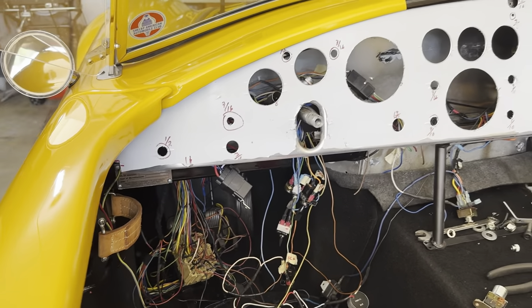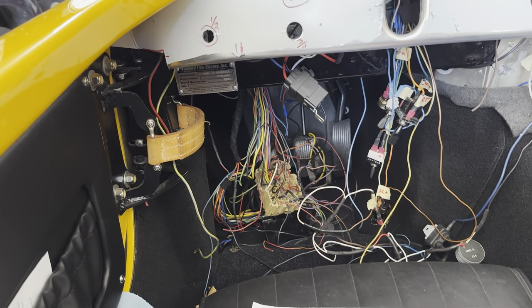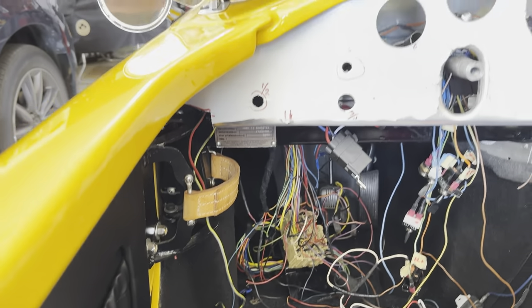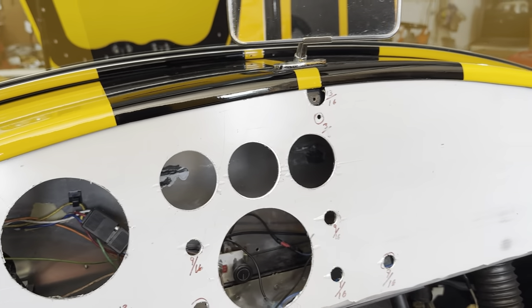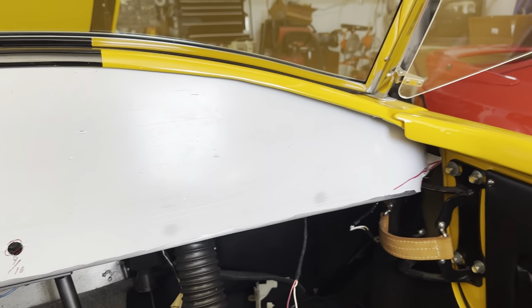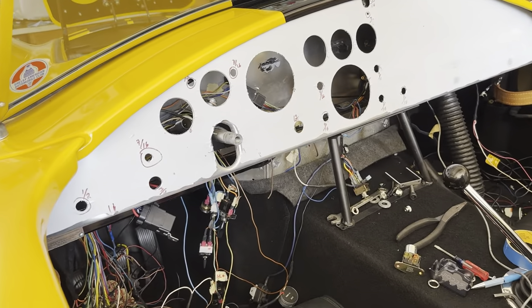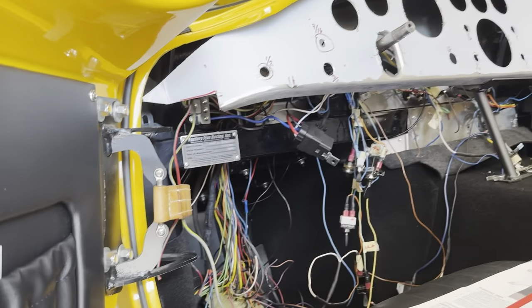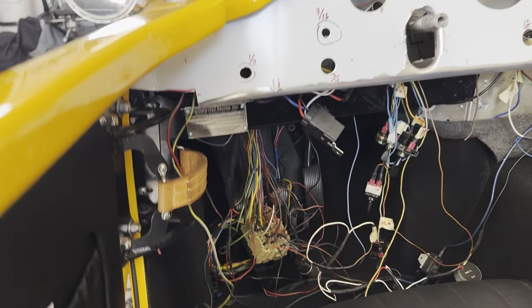Second cuts are made and we have a winner. You can see where I extended it to — plenty of room for the hinges. Everything clears fine, and it actually fits up against the dash crossbeam like it's supposed to. The other side is the same thing — plenty of clearance for the hinges. I've got the brace underneath kind of holding it in place. No issues. Everything moves as it should. I think that's going to be pretty good as far as the cuts and clearancing go.